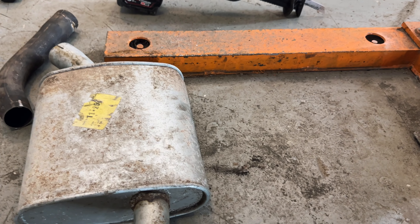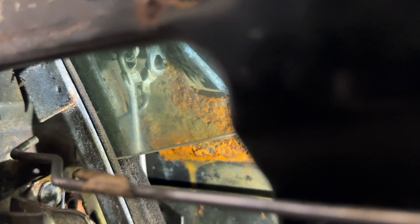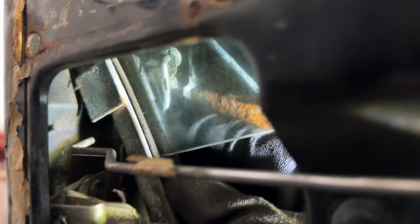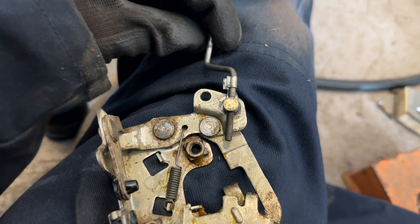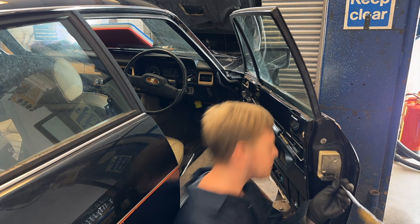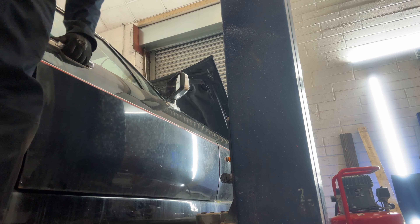That's a mystery to me. While working out the mystery, I moved on to refitting the door locks, finding the passenger door still wouldn't open from the outside. This was due to excess play in the pin here. So I wound it down, put it back together, lined up the pull rods, slotting them into place, using the metal clasp to lock them into place — and success. Driver's side back in, a bit fiddly, but with some persistence we got there.